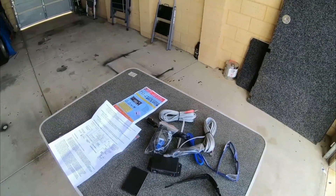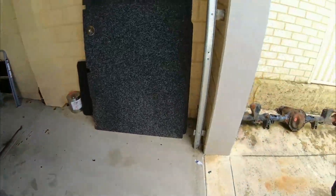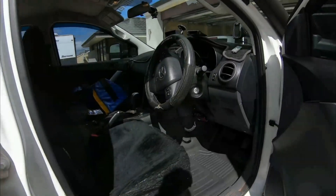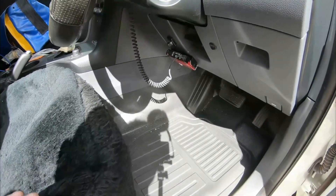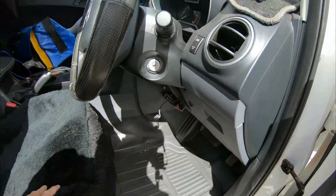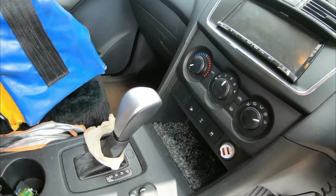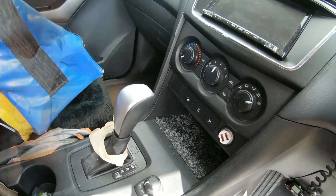The biggest issue with new vehicles is where to actually fit the head unit. I've got a BT50, but I already run a fair bit of radio there, and you've got the fuse box here which you can't really mount it on. Where I'd like to fit it would be probably right here in this space. The plan is to have a look behind that, whether I can drill a hole in the back of it and get it fitted up.